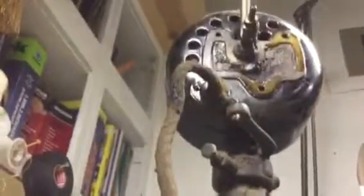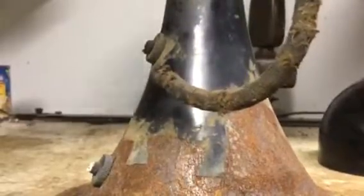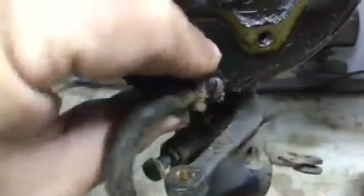We're removing the bushing plate here, and this is the screw that we couldn't get to with the gearbox in place. I'll use my makeshift tripod to hold the camera. The way this is made, it has a slot here, so you just loosen this screw and then remove that one. Very nicely made little screws — nice blue finish on that one still. We'll go ahead and remove the other screw too.